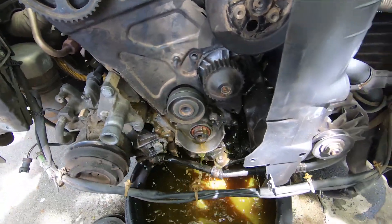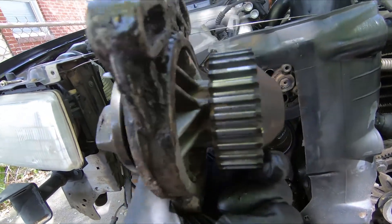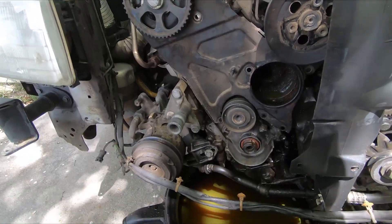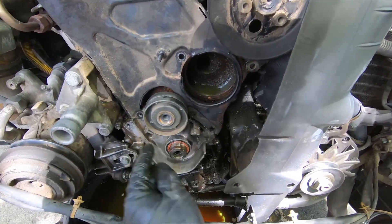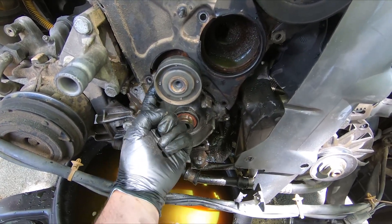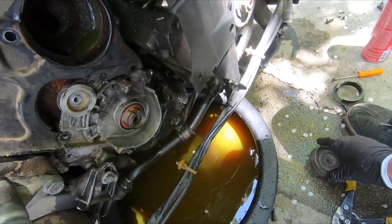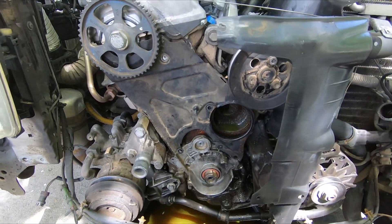Let that drain out. We got the water pump out and we're going to clean up the sealing surface. It's actually in great shape — good quality piece. It doesn't have markings to tell me who made it, but it held up really well with zero play. I still need to get the pulley off — there's a 10mm bolt and it's kind of pressed into the oil pump housing. Using prying tools from two sides, it came off pretty easy. It's an INA German bearing — good stuff was used originally. We'll clean both surfaces and reinstall.